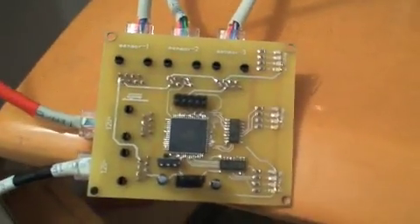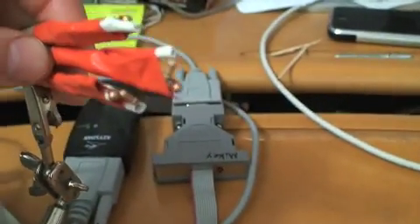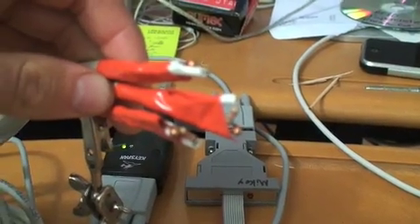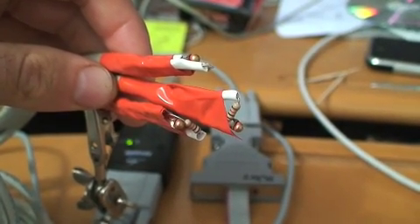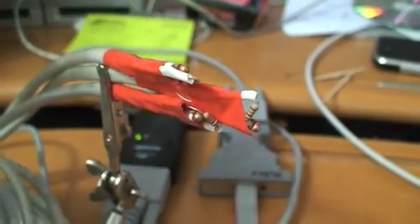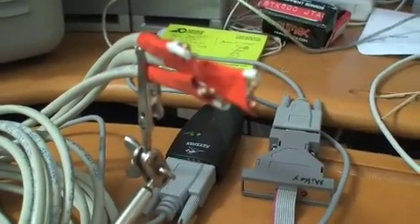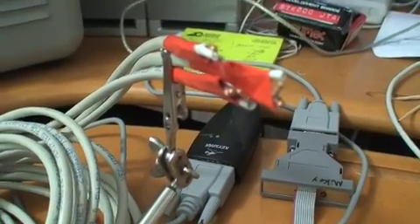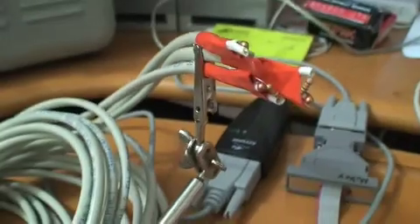Right here we have a Greasymon that is hooked up to three temperature sensors. I've used standard Ethernet cable with CAT5 connectors, so they just plug right in real easily. These are the three temperature sensors that would be placed in different parts of your vehicle. I put all three of mine on the grease hose just before the injector, just after the heat exchanger, and just after it enters the hood from the rear gas tank. The idea is that you would place these sensors in any area where you want to know if you have a cold spot or if the grease is getting to temp enough, and I just adhere them right to the grease hoses with some zip ties and then tape them down.